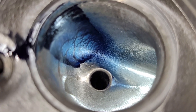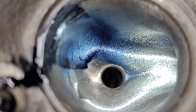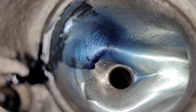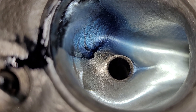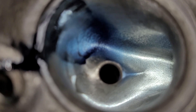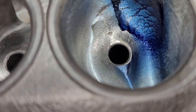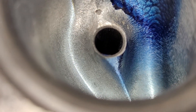This should be a pretty quick one. The only thing I did is the bowl blend, the pinch, and I narrowed the guide. Now it's not exactly the same design as DV did — it's similar but not the same. DV mowed that guide down almost a half inch; I'm going to leave it full length if I can. As far as I'm concerned, longer guides are better — even if you lose a few CFM, durability is worth it. The liquid actually looks pretty good. You can see some right on the guide itself — to me that looks pretty good.